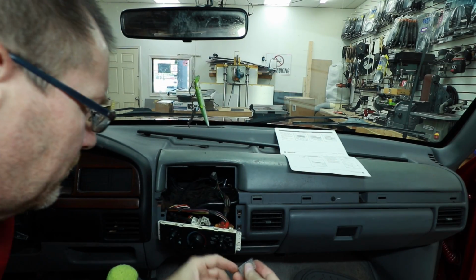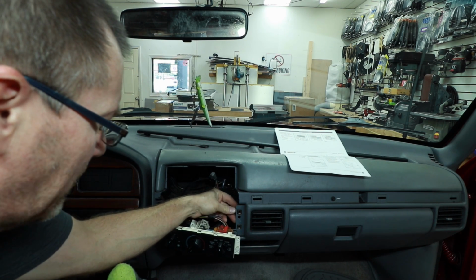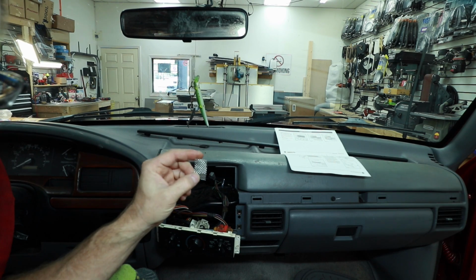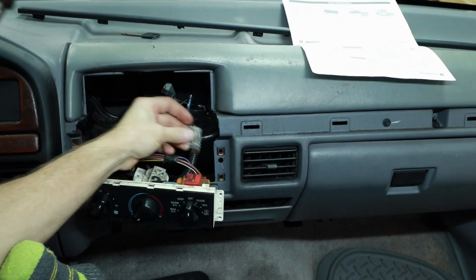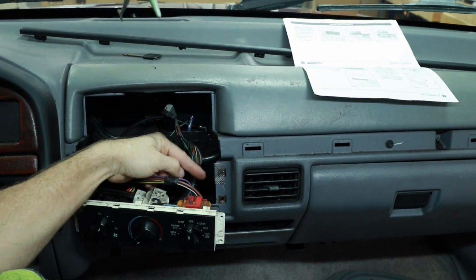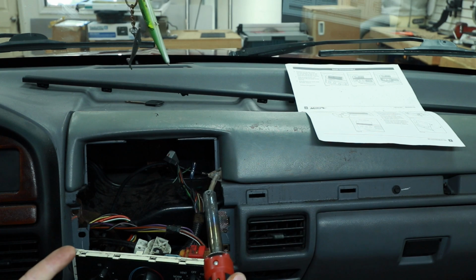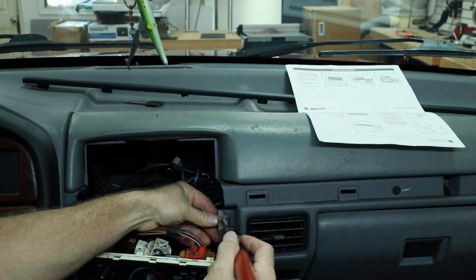Plastic welding, there's a couple different ways you can do it depending on what the problem is. On the passenger side, it's just starting to come apart here. For that, they make this screen. It's just metal screen that you'd use to screen a house, and it's designed to just put over the top of it. So put a slight bend in it so that it wraps around this piece of plastic here. And then to melt it, this is just a straight iron. You get these at the cheap tool store for pretty cheap.